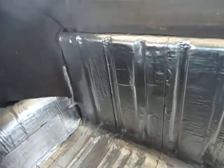We put in this really nice quick roof material, but it acts as a great insulator for noise. Thin tar strips with silver backing. Doesn't stink at all and cuts down the noise a lot. I ran out, but I'm going to put some on the inside of the doors and everywhere else, up on the firewall and along the center thing there. As I said, the seats were just welded in, holding together pretty well. Oh, hey, there's that screwdriver that I was looking for. I wonder how it got there.